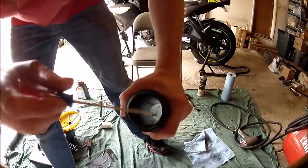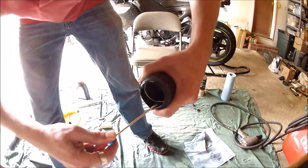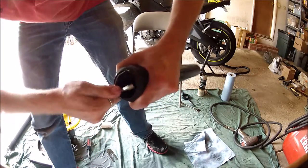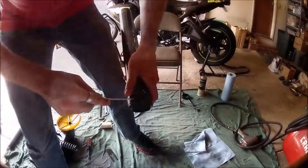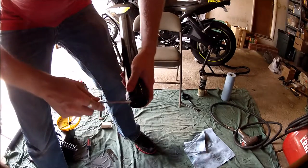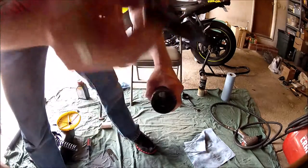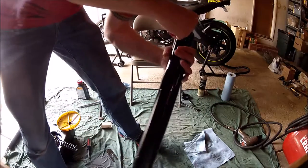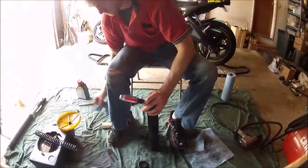Where we will be focusing our work is on the outer sleeve. As shown at the very bottom, there's a dust seal. What holds the seal in place is a snap ring. You'll need a small screwdriver to wiggle it around and you can easily pop out the snap ring. Once the snap ring is out, you can take that small screwdriver and work it around the outer fork, being careful not to scratch the fork tube. Once done, the fork seal will pop directly out.